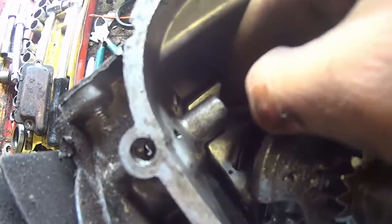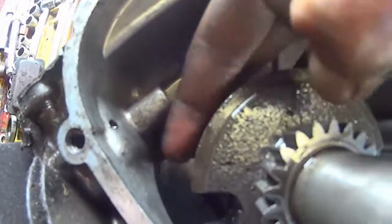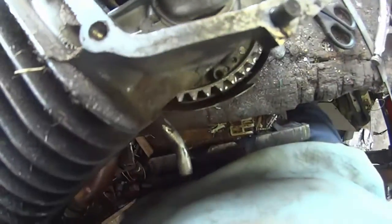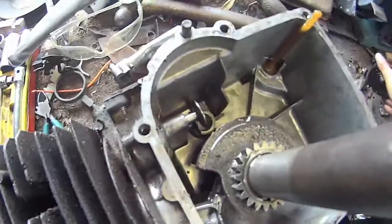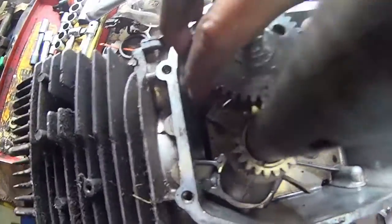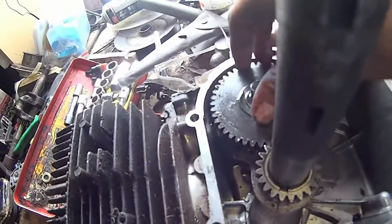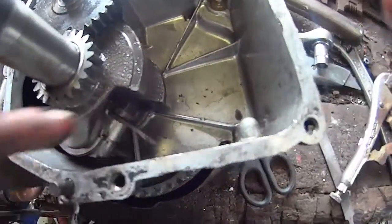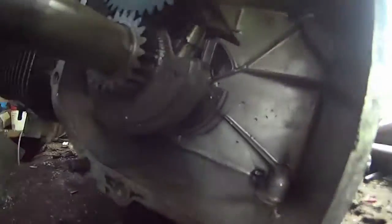So, tappets. This is very difficult — I have to try to get that out, it's way down in there. I'll need these tappets in and then I'll show you. And they're in. Now I'm going to get the camshaft, put that in there, make sure it's timed correctly — which it is. It's sitting down properly. So now we're going to turn the engine over and make sure that our little slinger doesn't hit anything. There you go — everything's good, it clears.